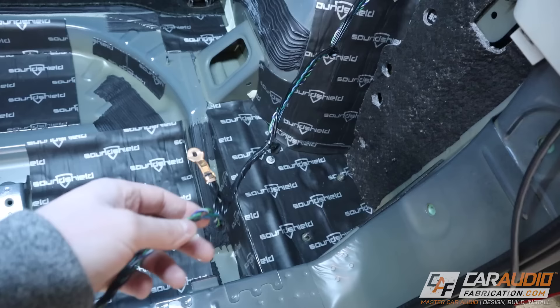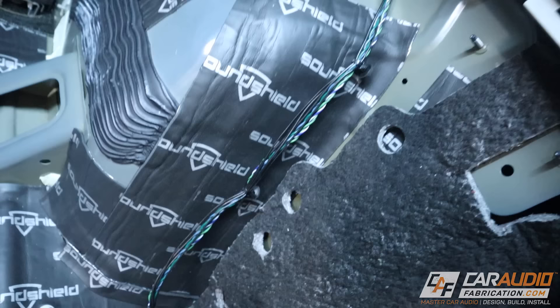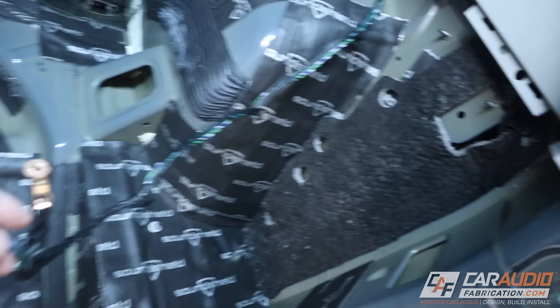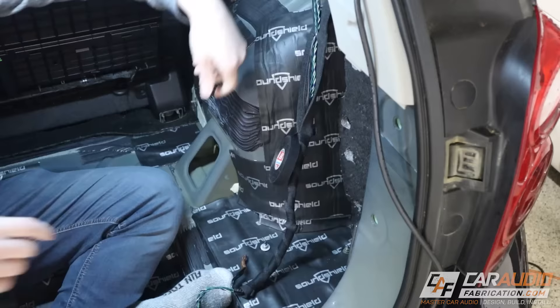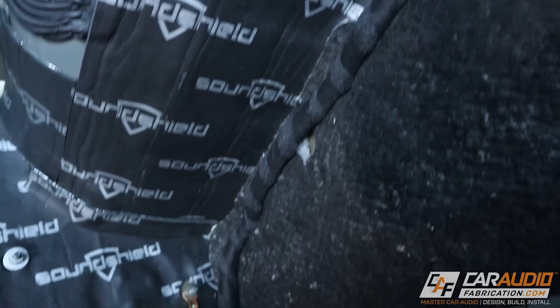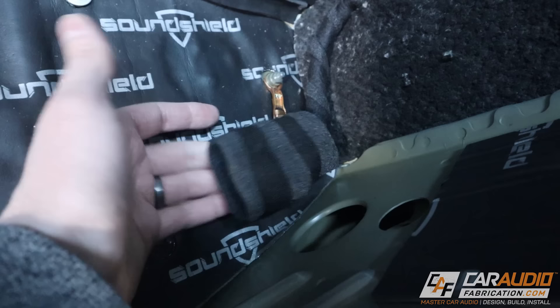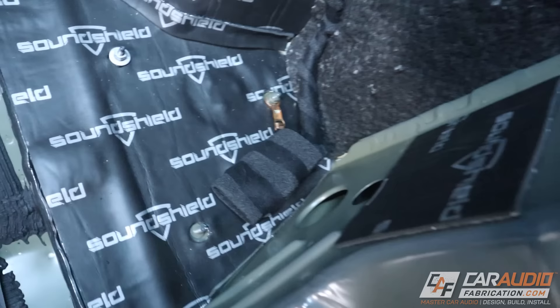There's another thing we need to address when doing this sort of targeted, efficient sound treatment — we want to look for other sources of potential vibration noise other than just the sheet metal itself. One problem we can sometimes have is wire harnesses. In this vehicle, anywhere that's near a speaker location, like in the front doors or in this case the subwoofer, I'm going to want to treat this. I'm using closed cell foam material — we're going to wrap it around the wire harness and then secure it using some cloth tape. Here's that wire harness completely protected with the closed cell foam — there's no way that's making any vibration noise. I also balled up the factory harness that connects to the factory subwoofer. We're not using that anymore, but I'm not going to cut it in case we want to return the vehicle to stock.